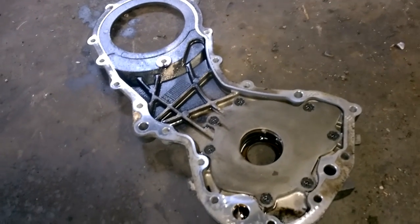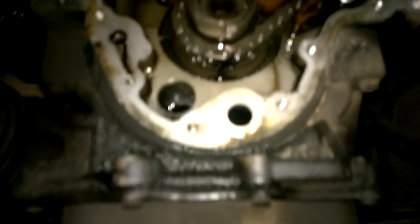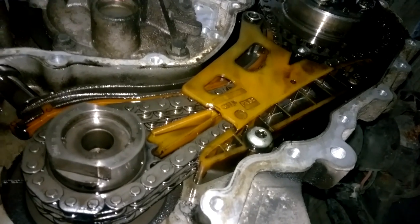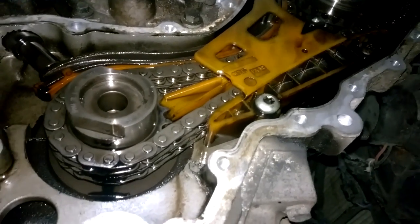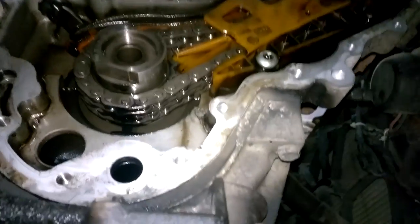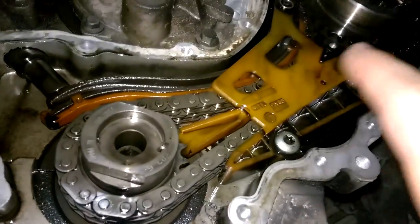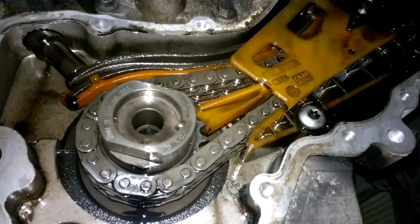I've now got the aluminium casing removed, and at this point is where I would be getting ready to fit the wet belt — but in this instance I've found that there's actually a chain behind it. Fortunately I won't have to replace it; unfortunately I've wasted a load of time. The information I got from the Ford dealership was that there was a wet belt in it — every Transit Connect we've done previously has had a wet belt, but this one has a chain. If you are doing the wet belt, you now know this is the area you need to be in, and these would be the components you would be replacing. I'll be fitting it back together with new seals and continuing on from there.